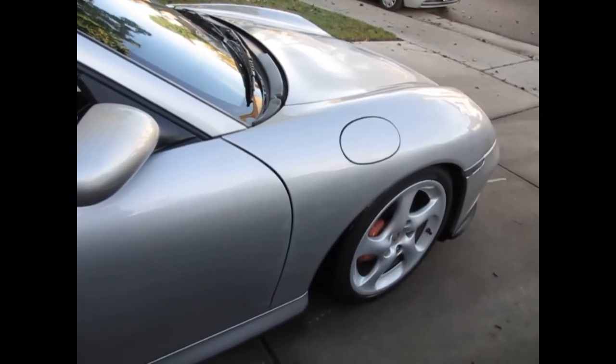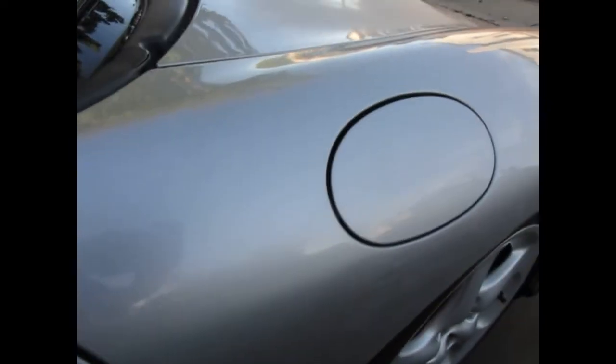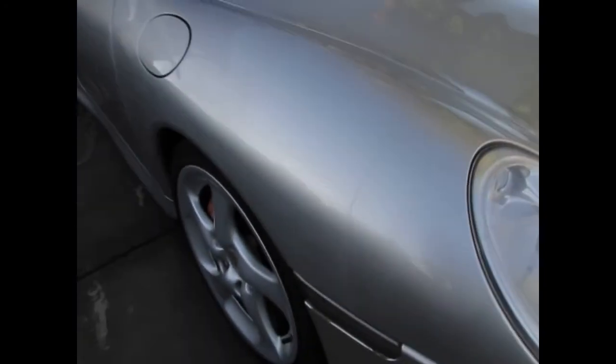Okay, it's been about 10 minutes. Stage two is nicely glazed over. I don't know if you can tell, but if you look at the door, it's kind of overlapped a little bit onto the door, and this is all glazed over. I'm going to buff that off. It's kind of cloudy. You can see my shadow. It's kind of fuzzy and hazy.